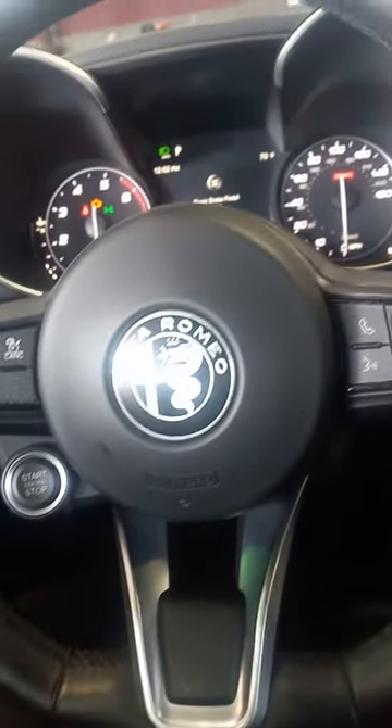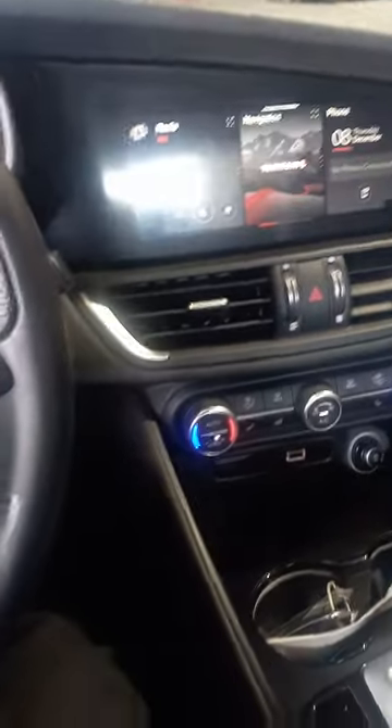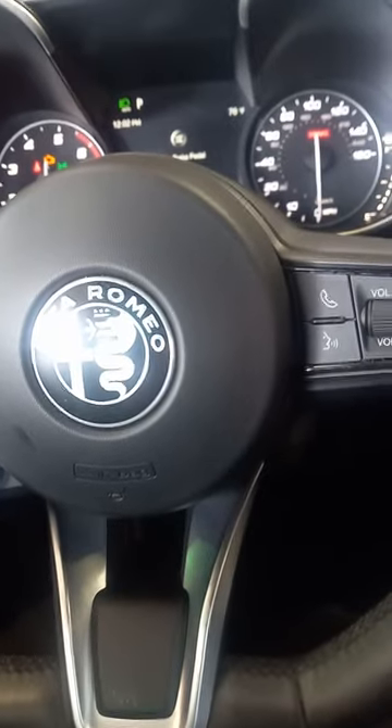With your foot on the gas pedal, press the brake six times: one, two, three, four, five, six — then hold it down for five seconds. You can see my feet down there. Hold the gas pedal and brake together for five seconds, then let it go and take your foot off the gas pedal.